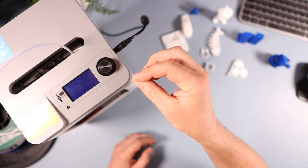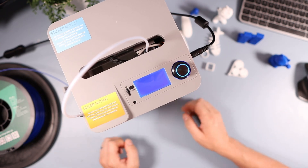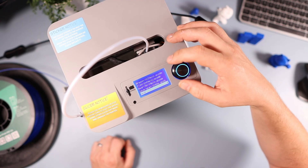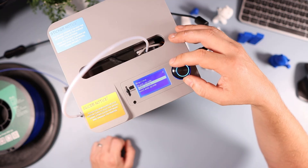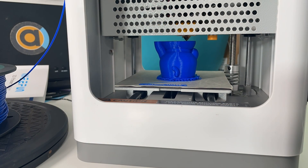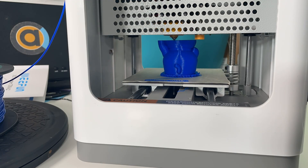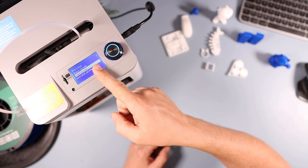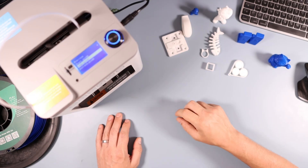Back at the printer — we've just ejected the SD card from the Mac. Pop it back into the printer, turn it on, wait for it to boot up, then go down to Print from SD. Navigate to the last page because files are ordered by date added — there's the yoda and the PlayStation stand, the last two we added. Click it and it starts printing. When it first starts it might show a crazy estimated time, but once it's actually going it gives a more accurate estimate, which is quite accurate. Really nice feature.